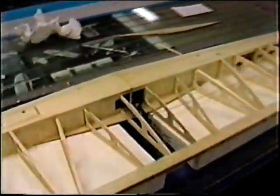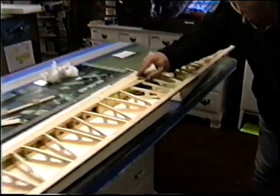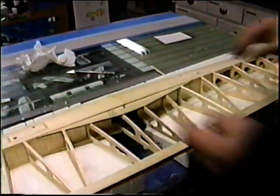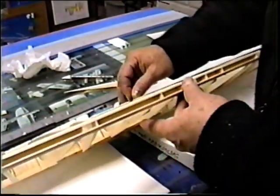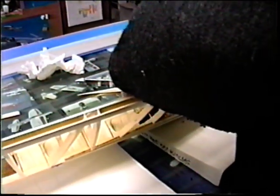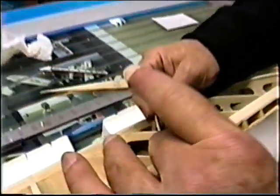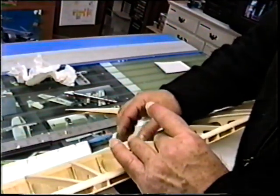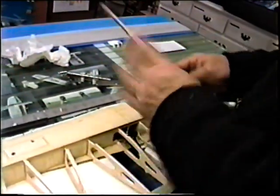With a bent push rod or something. No. The resolve on this was that we had to cut the bell crank bolt enough. Show them how you can take that out now. We had to take enough of it out that you can take the bell crank. We cut the bell crank bolt to exactly the size we needed. Well, actually, he's going to have to do it at home. Okay, but now you can get it out and you put the ball link on the bell crank. Now you can move it in and out. Wow. Yeah, that's okay. One bullet ducked on this project.